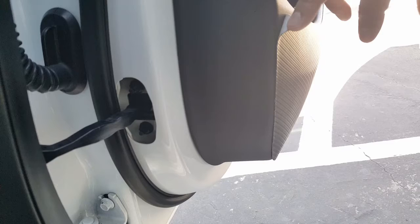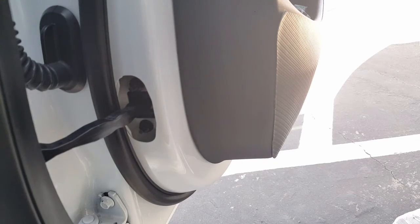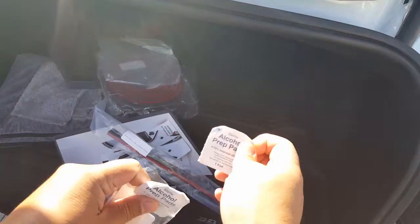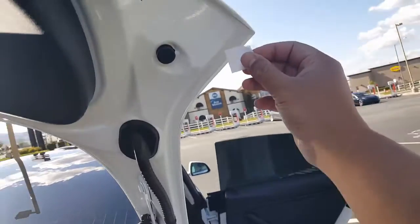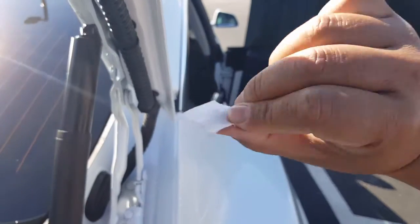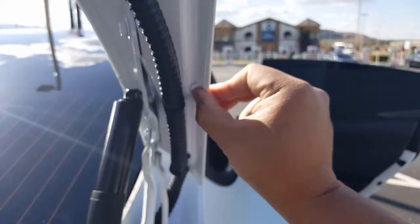See if it can better cause it not to lift like this again. I'll also use the adhesive promoter on the other side. First of all, you want to clean with alcohol — just to clean the surface area from dirt, so there's no dirt or anything. One little pack should cover me for these three small areas — that's the side of the triangle. Just give the alcohol rub to areas we want to clean.